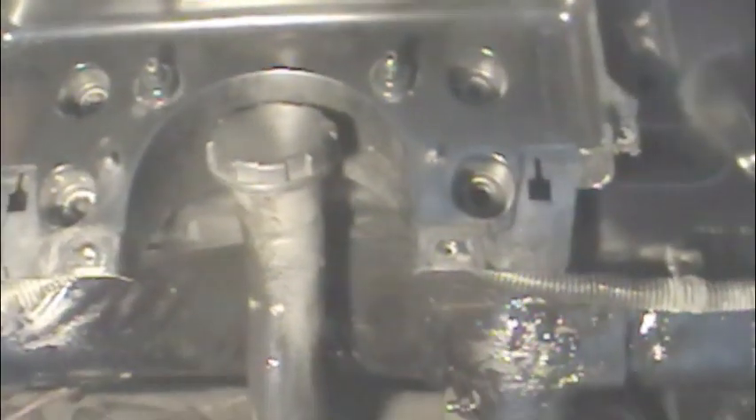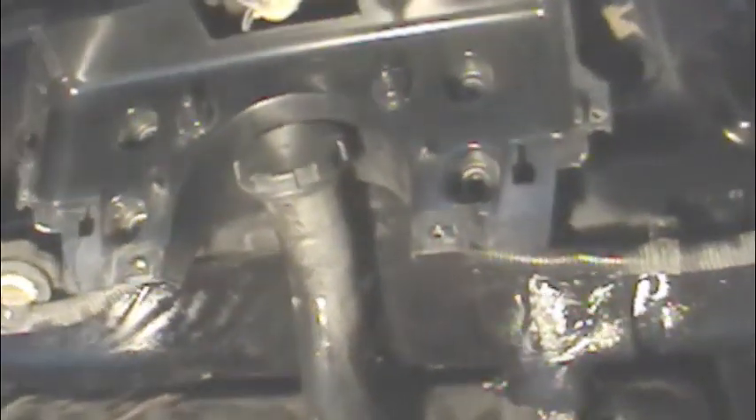All the lights are removed. When you do bumper fillers, it's a given to pop the tail lights — that's only about ten minutes — along with the wiring harness. There are also a couple of quick spin nuts on the cover for the plate and the fuel door. These would be the position seven pucks — body mounts — and they're not looking too great either. I'm going to drop this frame amid removing the column and some other things, and that way we can separate the body from the chassis.